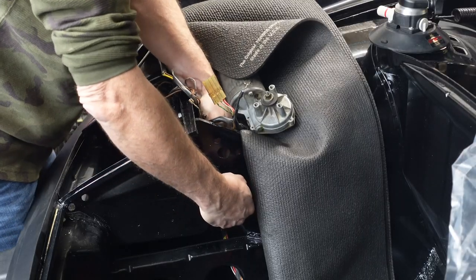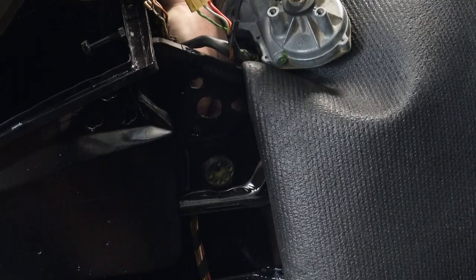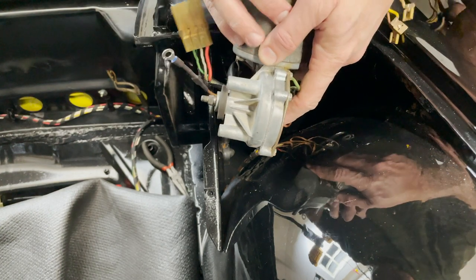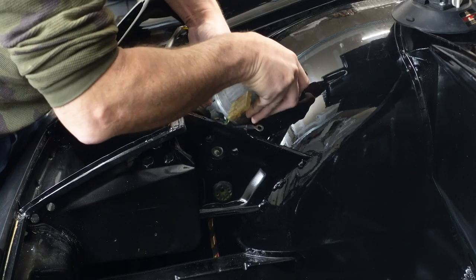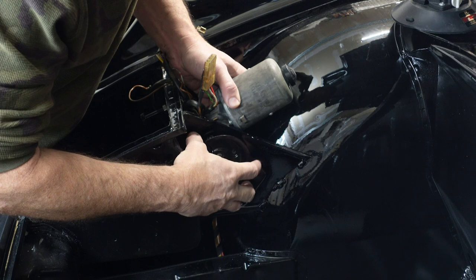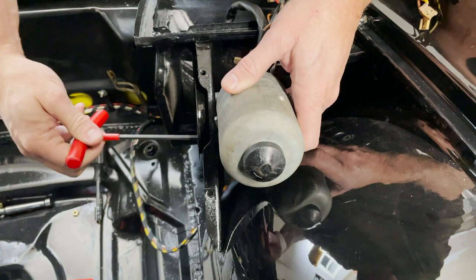It's way easier to put the relay socket into the body first, so I'm resting the motor on something soft and then just working it in. I want to make sure that this insulator is on, and then really carefully move the motor into position, avoiding the paint at all costs. We'll put it through the metal here, then grab that little ring and put that on and align the holes so that we can take the little bolts and screw them right in. We'll just tighten things down here.